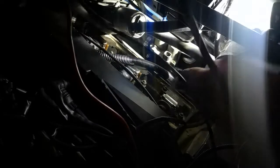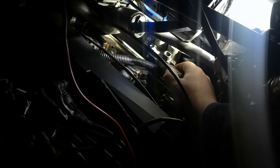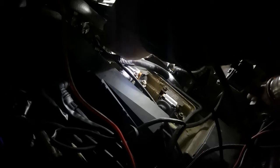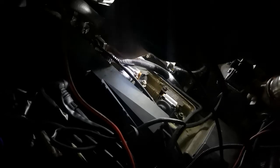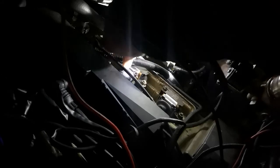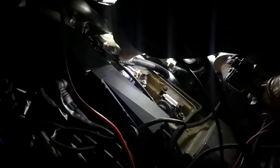And then there's two more. Under there's where the electric connector goes in, and there's two pipes there. The bottom one is the inlet, and the top one is another outlet. So one's to the passenger, one's to the driver's side. So we'll undo the Jubilee clips off those two, and the top one first. It's quite difficult to get your hand down there. I'm gonna have to take my watch off.